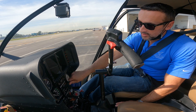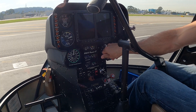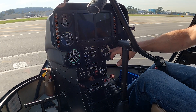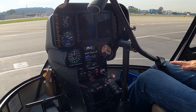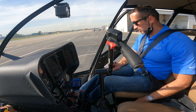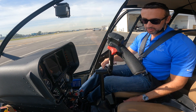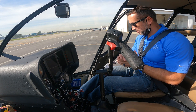Set the altimeter to field elevation — we'll set it to about 40 feet in the Kollsman window; it's 30.30 right now, and we'll verify accuracy when we get the setting from the tower. The hydraulic and governor switches are on — the hydraulic switch is on the cyclic, push it up to make sure it's on, and the governor switch is always toward you. That's the pre-start setup done.